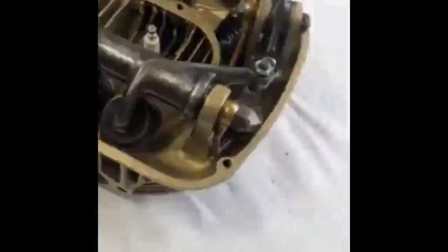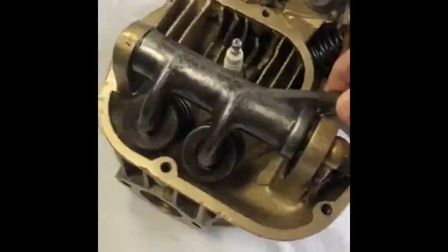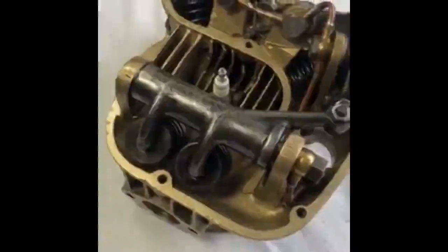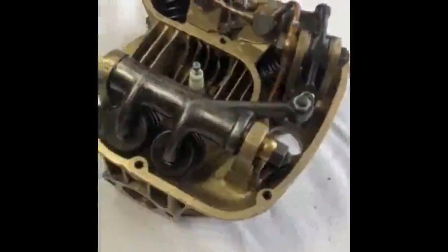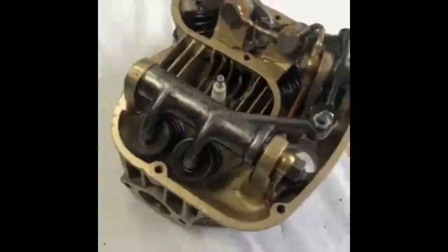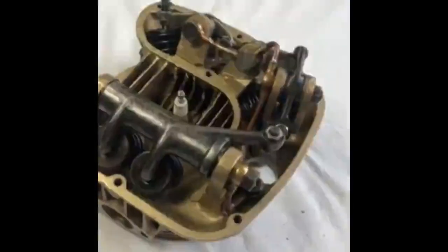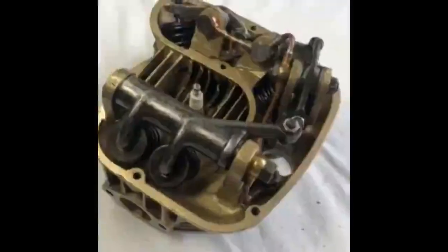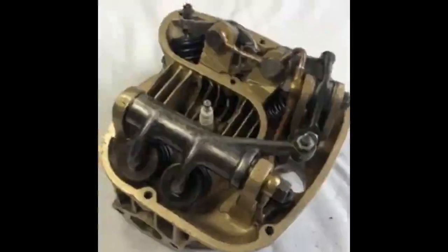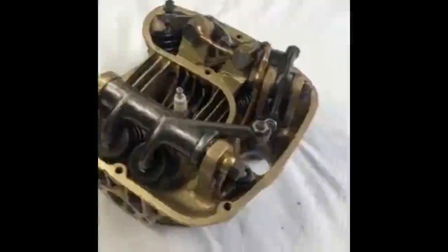The inlet rocker side-to-side play should be minimised as much as possible, again to prevent excess oil from leaking from the inlet side. Once the head is assembled, then the rocker box should be added to check that it fits cleanly, snugly and flat on the head, and do this without a gasket being fitted. This will ensure that when the gasket is added, it will seal adequately.